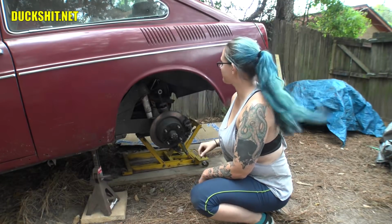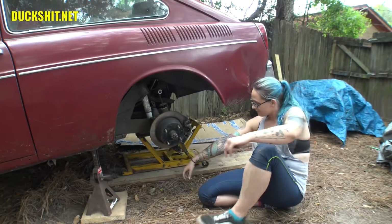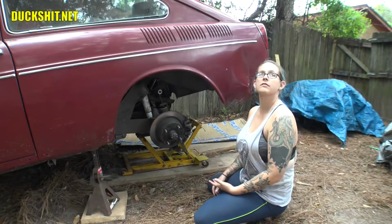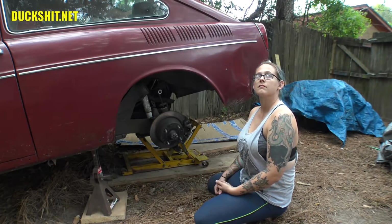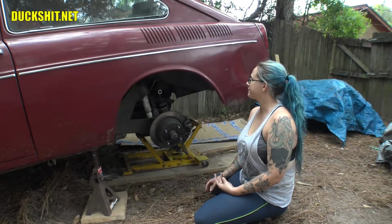It's attached at the bottom to a sway bar. That's that big gold rod that we were talking about earlier underneath there. Yeah, that's attached at the bottom. It might try to spring loose or something, so don't be surprised when you get the last thread off on the bottom if it just snaps a certain direction. It won't go far, but it might go boom, just a little bit. So be prepared if you see it. But you should be okay.